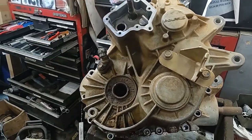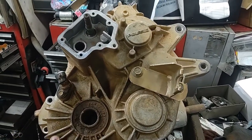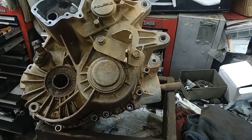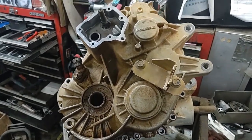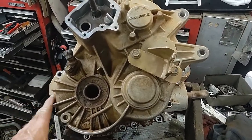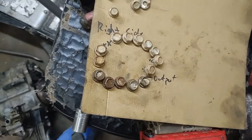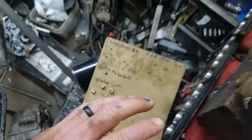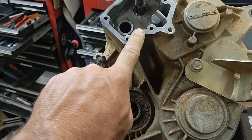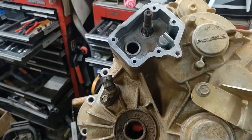So this is somewhat of a standard transmission. I found out in working on these that there's a whole bunch of different gear ratios and different transmissions - I don't know why they didn't figure out one and go with it, but they figured out five of them. I've already got the bolts out - there's just a ton of 12mm headed bolts. I also removed the gear selector cover, and I will show how to put that back together. There's also supposed to be one other shaft in here and I have it in my box of parts.